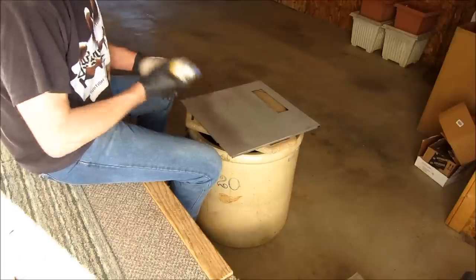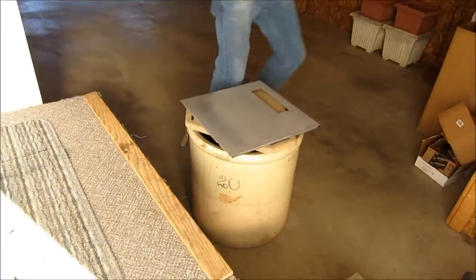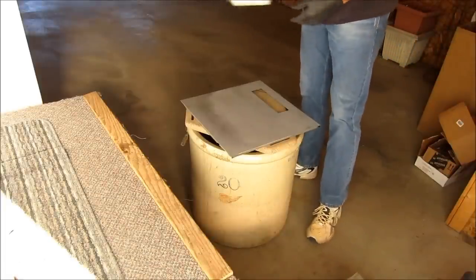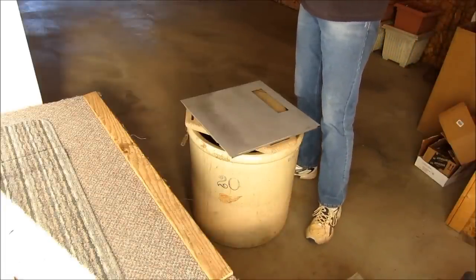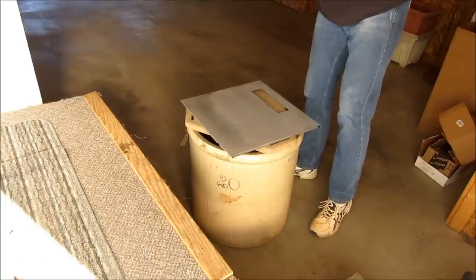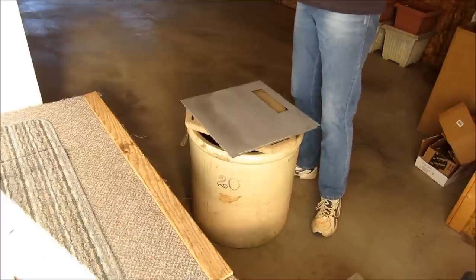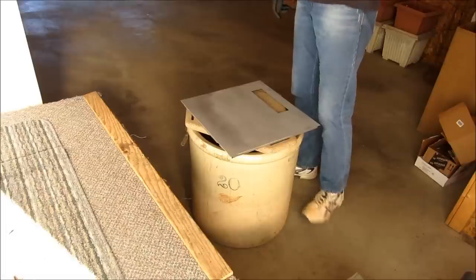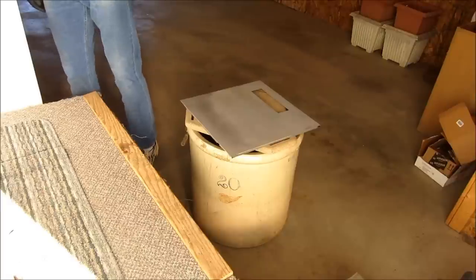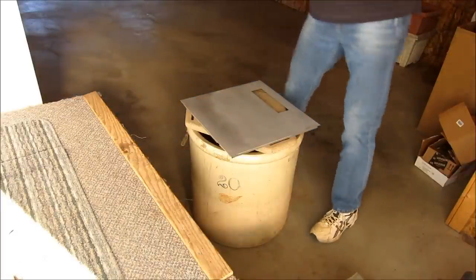And for what's going to go on here, this type of primer is fine. And a lot of us are going to be using cans anyway. You know, not a lot of modders have the compressor and gun set up. And I'm right at the minimum temperature out here today. It's 60 in the garage. 61. And my minimum temperature on here is 60, so right at the minimum.